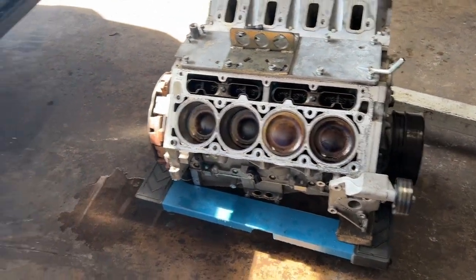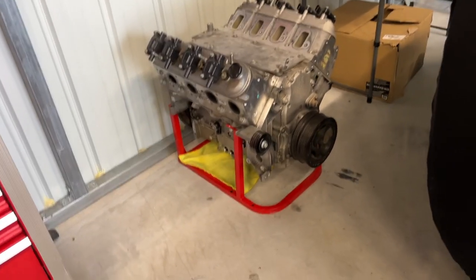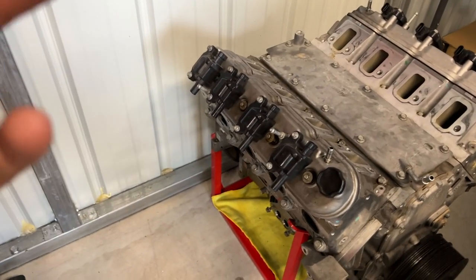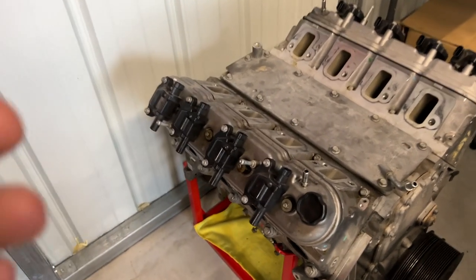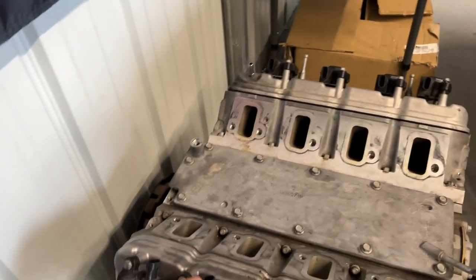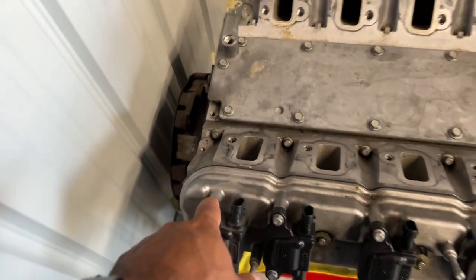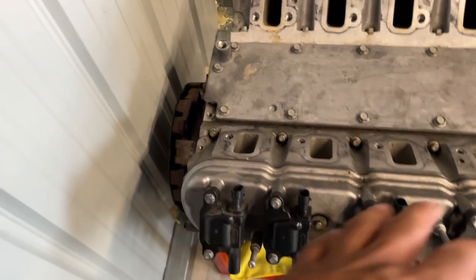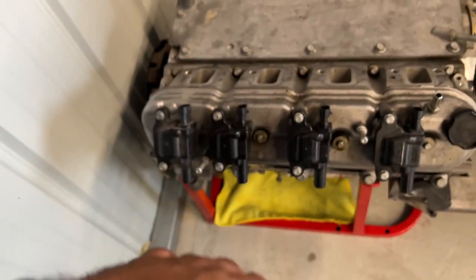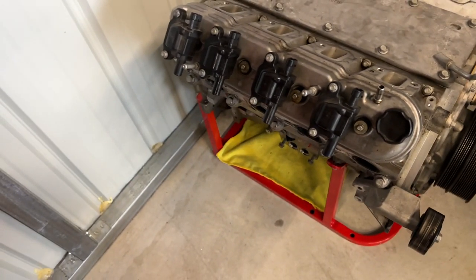The heads are still good. As you can see, I broke a piston — actually broke two, but you can only see one here. Numbers eight and six are actually broken. You can see number eight at the top; when I took this all apart it had oil inside the intake runner, whole shebang. And as you can see, it scored up the cylinder pretty well.